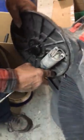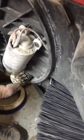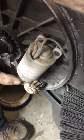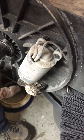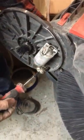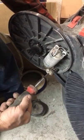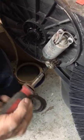Now check your pinion. If the pinion is stripped, all the teeth will be removed. Also check your worm gear — if the teeth are missing here, they're going to be worn or missing as well. This one appears to be in good shape, so remove the long screw from your pinion, holding your brush holder on the inside while you remove the screw.